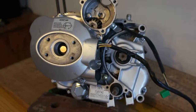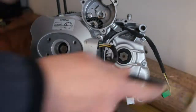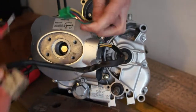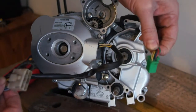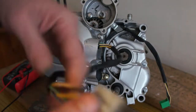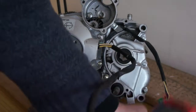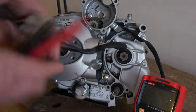I'm going to take this side cover off and look at the stator and the flywheel. I haven't got a flywheel puller at the moment so I'll wait for that, but for now I'll take this off. You've got five wires on this, and also the neutral switch has got five wires as well. It must have like a dashboard PRNDL sort of thing where it tells you what gear it's in, but I don't know that for sure. Best to check your wiring diagram. Same with this one — it's got five wires. Let's do a test on this.